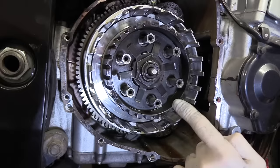Now, low torque settings like 8.8 Newton meters for something like this, they're not necessarily about making sure it's done up tight enough. In fact, they're there to make sure they're not done up too tight and you're not stripping anything off. And also at the same time, that all of them are even and tightened up to exactly the same torque spec. And that's where investing in something like that, or a cheaper one, just a small torque wrench, little quarter drive one, so you can do that sort of thing up every single time.